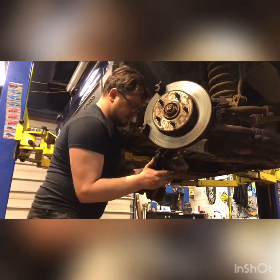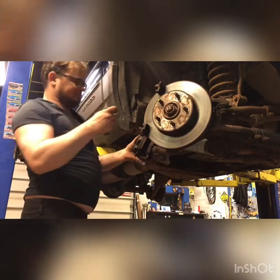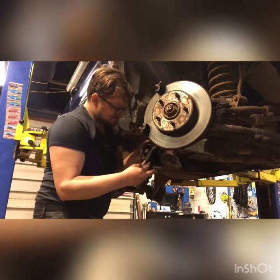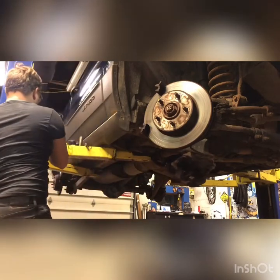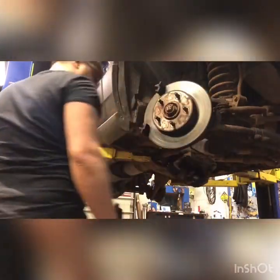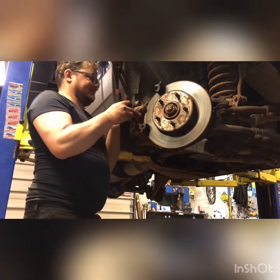Yeah, these pads are rusted up in there. Both front tires were smoking after a drive after sitting for a while. I suspect both calipers and brake hoses should be replaced. Brake hoses look nasty. I've got the go-ahead to do whatever I need to do on this one.